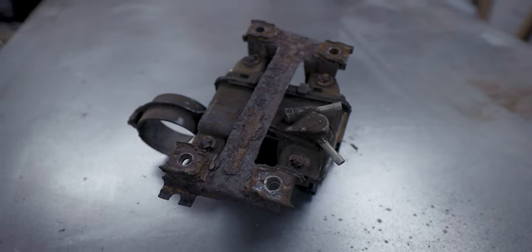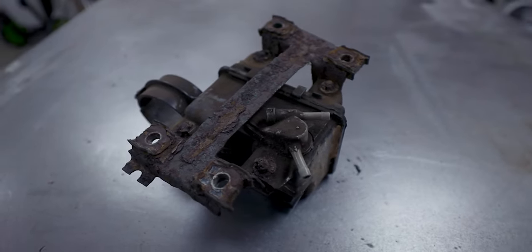After spending a little bit of time on the fuel system, I figured out that both fuel pumps are bad. There is one inside the main tank that was bad, and I went ahead and just replaced that one. And then there was the one inside the surge tank, which was bad. And the surge tank is pretty bad as well.